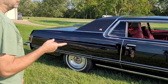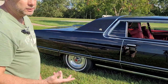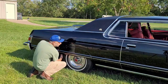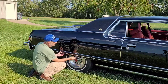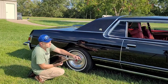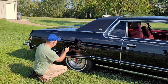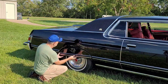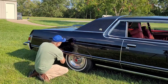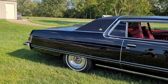The first thing I want to do real quick is show you guys how easy it is to take these fender skirts off to clean the wheels and tires, because there's been a lot of discussion about fender skirts lately because of Art's '58 Chevy. On this car it's real simple — there's just a lever back here that you push up with your thumb, pull it out, pull down, and just like that the fender skirt comes off so you can scrub your wheels and tires. Then you just realign the pins and lock the lever back around behind it. Pretty simple.